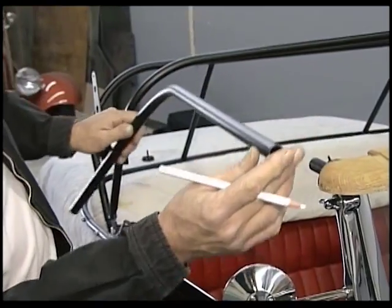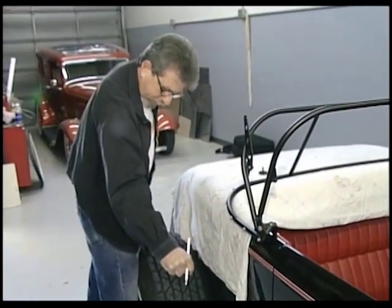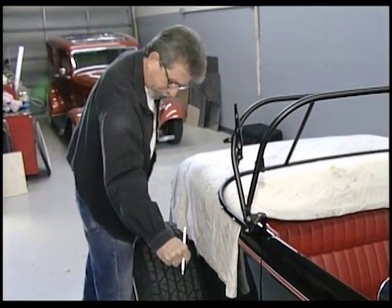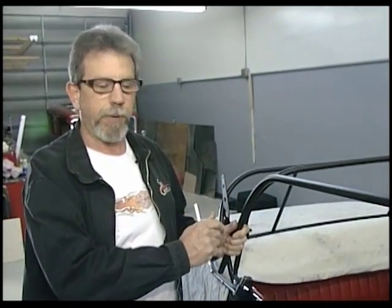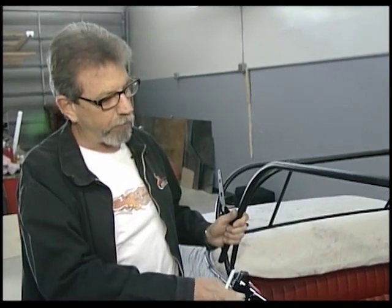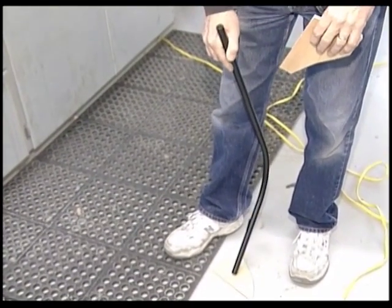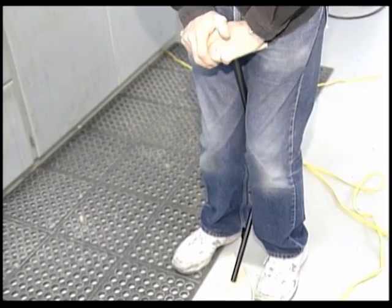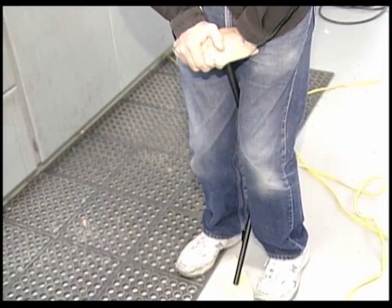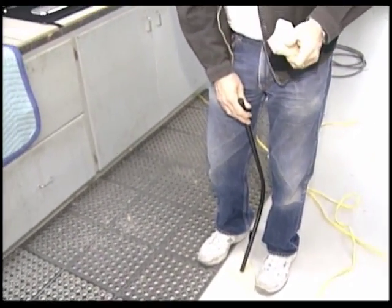If we didn't have enough bend, I'll show you a simple way to straighten it out. We take it on the floor, put a piece of wood to protect the tubing, and just put a little bit of pressure down on it — you'll feel it. Just sneak up on this. Don't go too much; go back and forth, try it on the car, and sneak up on it until you get it right. These are all powder coated so you can put a little flex either way and it won't hurt the paint.